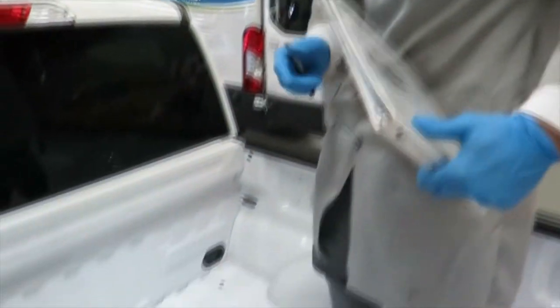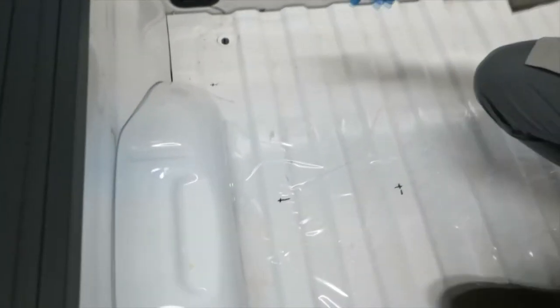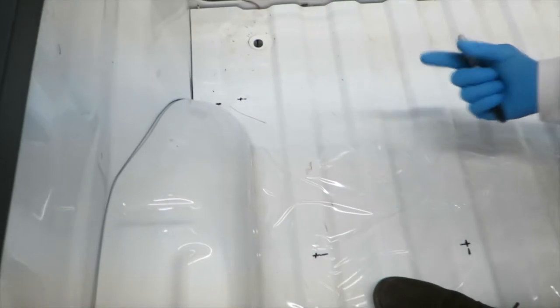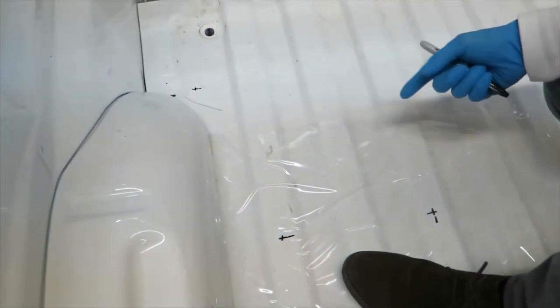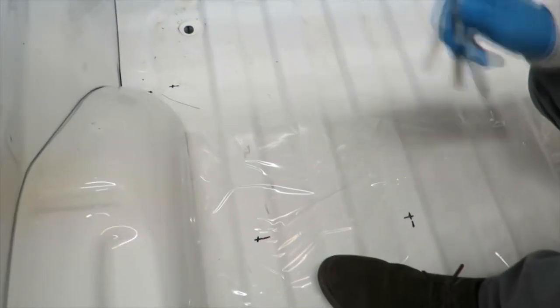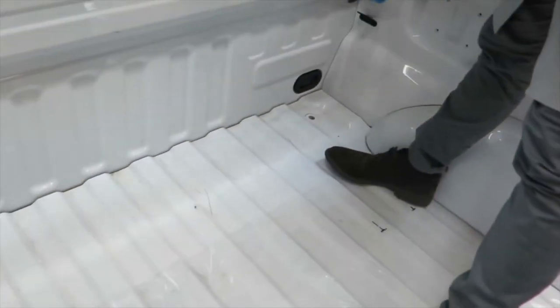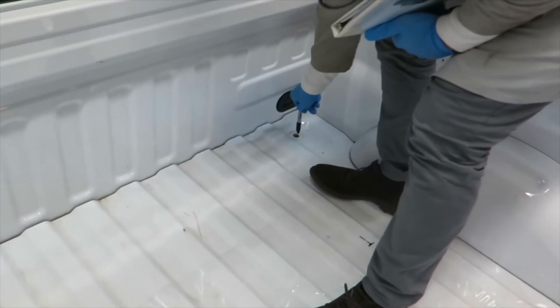Going through my manual layout, I went ahead and measured out all my dimensions. Got the first hole right here, which is for your coolant lines, low pressure line, fill line, and your low rear harness line. You've got your first bolt, second bolt, third, and fourth — these are all the mounting bolts. You're going to put the longer bolts from the kit in the OEM spots, so those are two bolts in the front. Now we'll pre-drill.